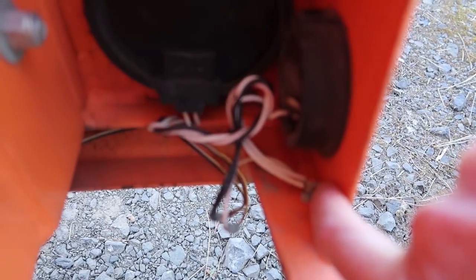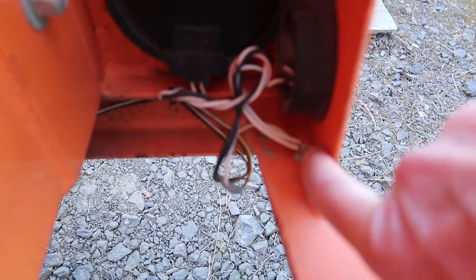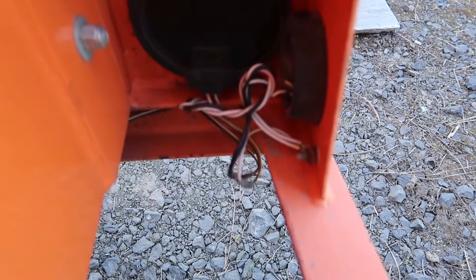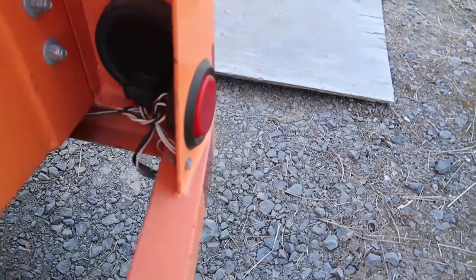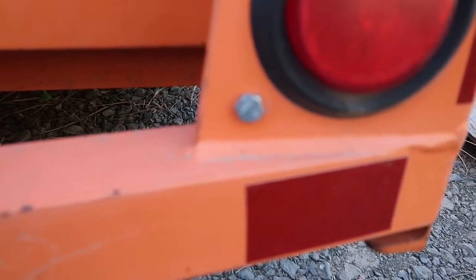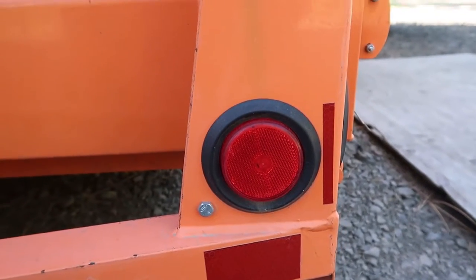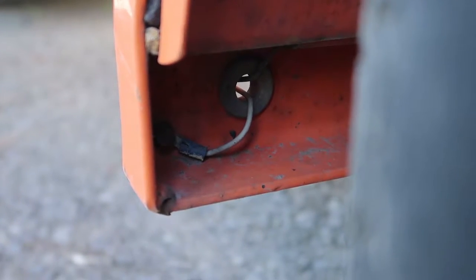Number two — it's kind of hard to see back here — but I absolutely hate it when trailer manufacturers use the chassis or frame of the trailer for your negative connection for the lights. Granted it's good to have the electrical system grounded between the truck and the trailer, but you should not rely on the chassis of the trailer to provide a ground connection for your running lights or tail lights. When that connection goes bad — which is bound to happen on a rental trailer driven all times of the year — those connections can get corroded, and when they get iffy the lights start to do really weird things. A little side marker light on the front edge of the fender is also connected to chassis ground.